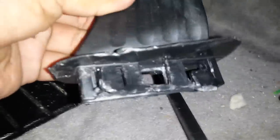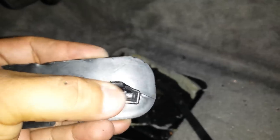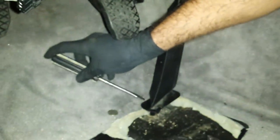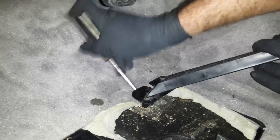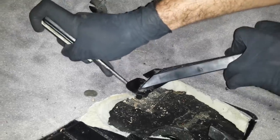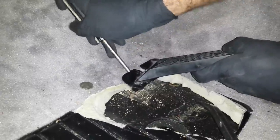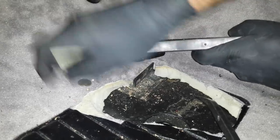This is how it looks. It's these pins right here — you see in the bottom, the pins right here — they attach to the base right there and right there. You have to push them out. The way I would do it now that I know how: once you remove the center pin, you would just take a flat screwdriver in the back, push it from behind, push those tabs out, take that out, pop one out, then go back there again and pop the other one, and then it comes out.